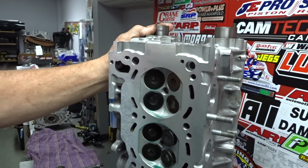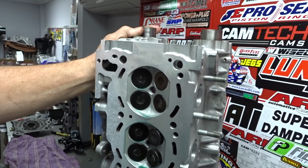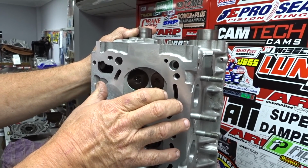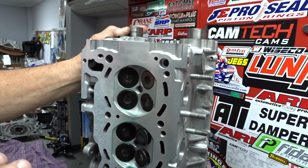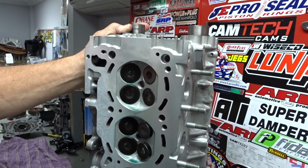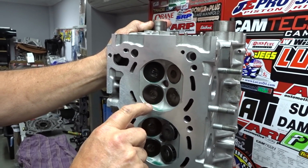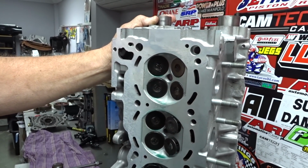I don't even know where they get taught this sort of thing. It's not the case. It's common knowledge that you've got to have the quench pads. If you look at any real high performance motor, something that makes a lot of power, turbocharged or not, it'll even have little cloverleaf pieces around the valves. So they actually have 4 quench pads here, like the real high horsepower European stuff. The chamber design has got to have that quench to burn properly.